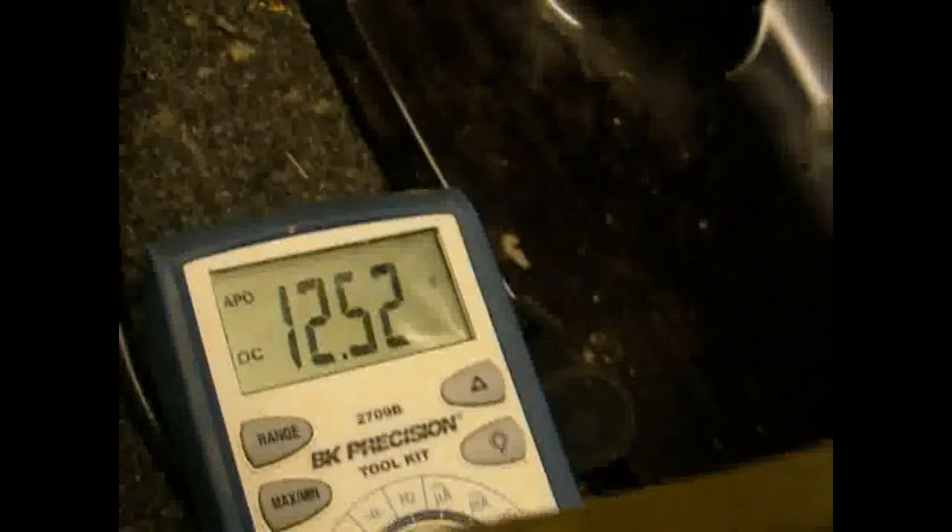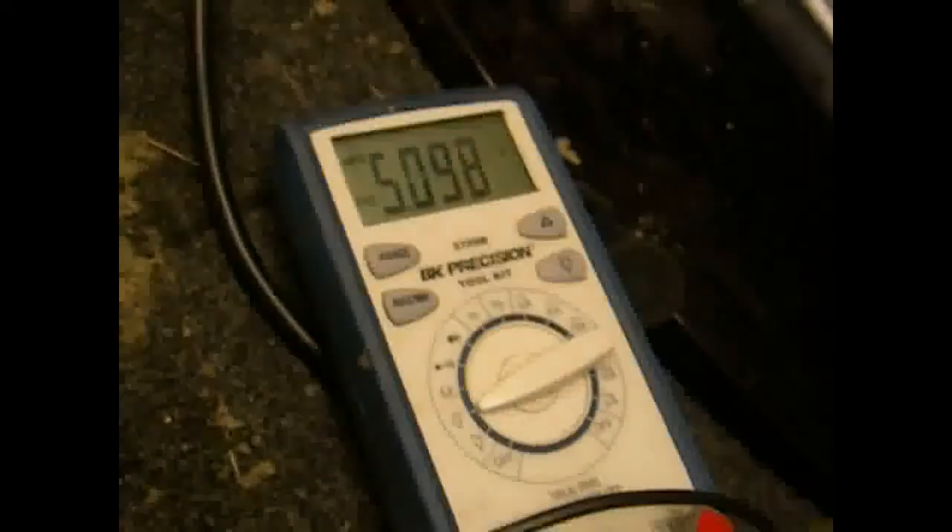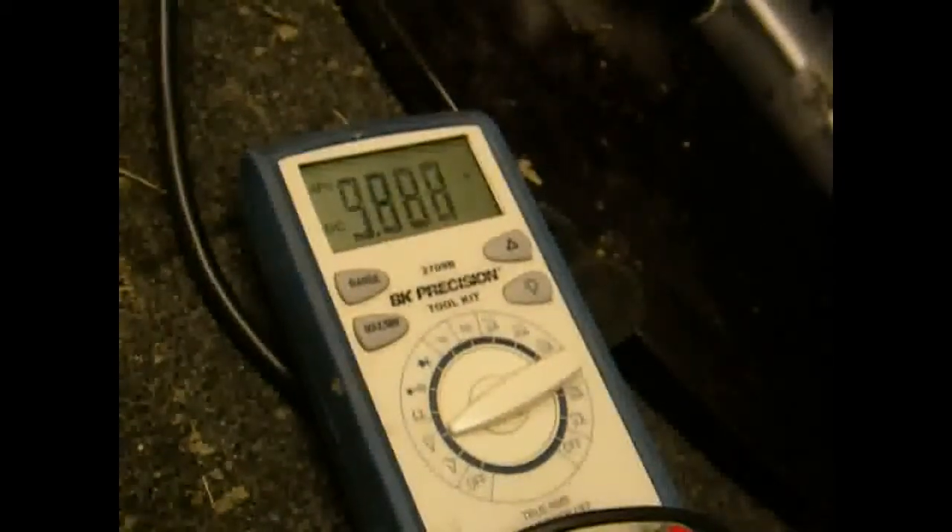Just as a little aside — when you're testing voltages on the power rail for this Samsung, which is not powering up: if you watch the supply voltage, we know it runs at 11.8V. So 12.5V sounds great, but then everything starts switching on in the TV and you see it drop to 11.09V, and then the TV shuts down because it detects that it's too low. This cap here — I think it's possibly the 5V cap, because it's reading 4.70V. The 5V rail is reading about 5.3V. That seems alright, so it's probably the 13V rail that's the biggest problem.